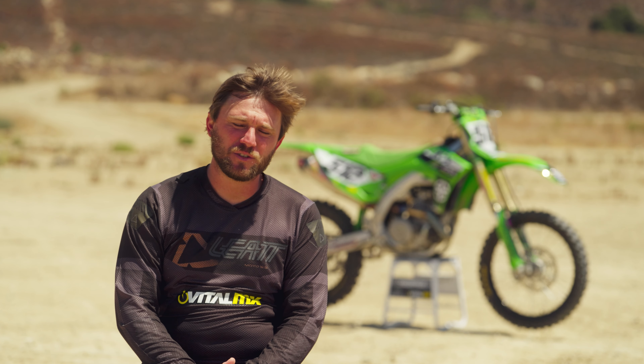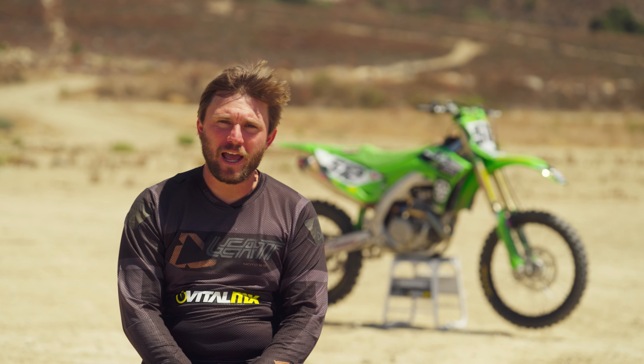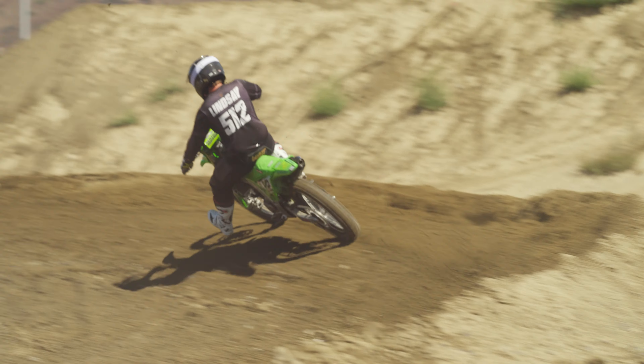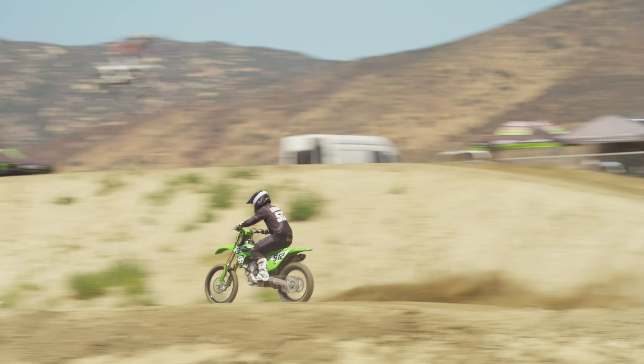The stock Kawasaki for me is better than in years past in terms of balance, but it is still overpowered by the rear — the front is weaker in damping character. With this new chassis being pulled in on the steering angle, it ends up being a little unstable under heavy braking when it loads the front end really hard. Factory Connection gave me a stiffer fork, but it still has a lot of comfort and movement — it isn't too stiff. Even filming today, I had comments about how smooth and stable the bike looks, and that's exactly what I notice.